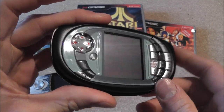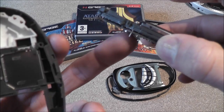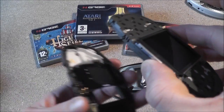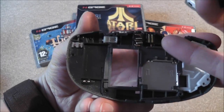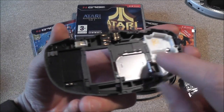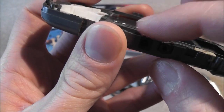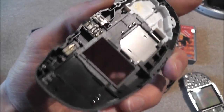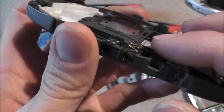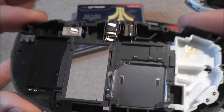I'll start taking this apart. That's the main parts of the phone disassembled now and it wasn't too difficult — just a few screws on the top section. This is the back plate of the housing. There are a few components embedded into the casing here: you've got the headphone jack and the power jack, and also the motor with the little weight on the end of it — that's the vibration feature. I'll need to remove those, but they just connect onto the motherboard with spring contacts, so there are no wires. It just touches onto the motherboard.